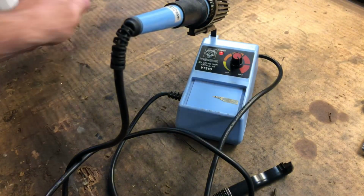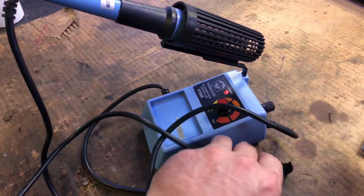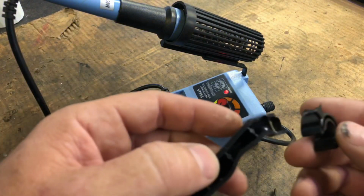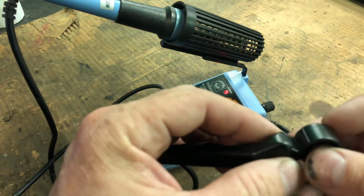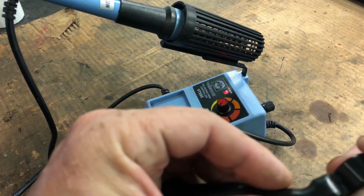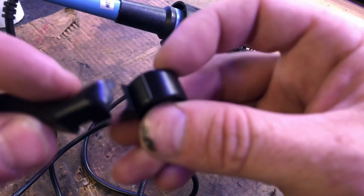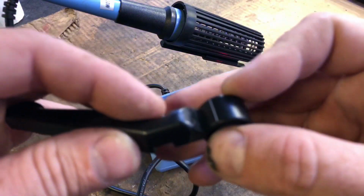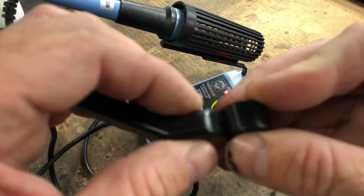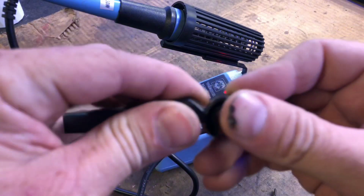So we've got the soldering iron over here heating up. I've done this before on a lot of motorcycle plastics. You can just kind of heat these items up, if we can focus good enough. So I'll just heat up the crack, I'll hold it together, heat it up right on the crack and just kind of melt this together.